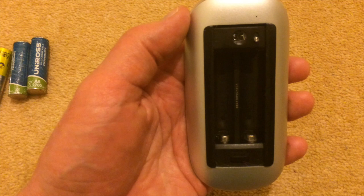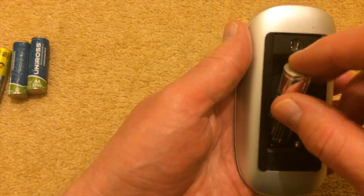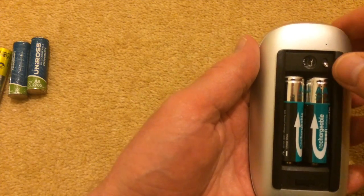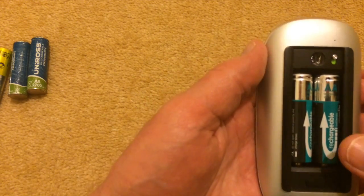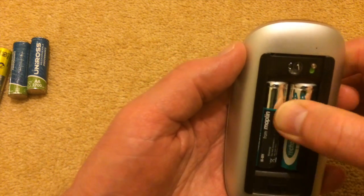These are batteries from Maplin with a total length of 50.08mm but with a tip of only 1.25mm. I place these batteries into the mouse and switch it on, and as you can see there is no green LED. These batteries are fully charged but they do not reach the positive terminal of the mouse because of their size and small tip, and therefore do not work.